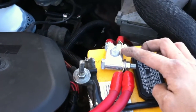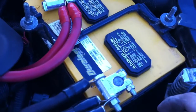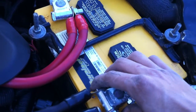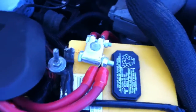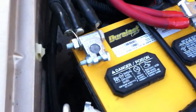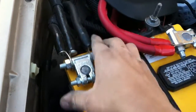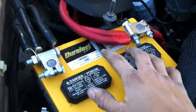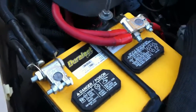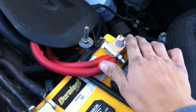These terminals are cool — they are called military battery terminals. Really awesome. I'd recommend those; they're way better than the trick-looking little set screw type with little covers and flashy colors. Those are pretty useless — whatever those brands are. These are real heavy-duty; you won't ever have a problem. Great conductivity. I recommend these for your battery terminals. If you have these kind of batteries with the up posts, they work out pretty well, and you can put a lot of accessories in here — plenty of room to add wire for upgrades.